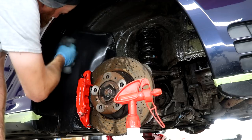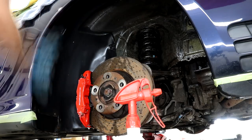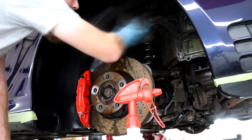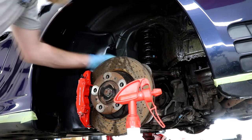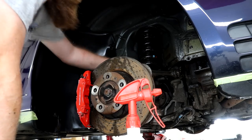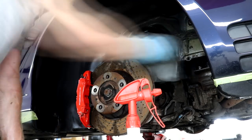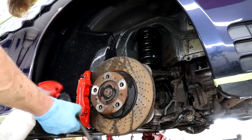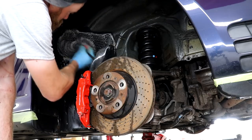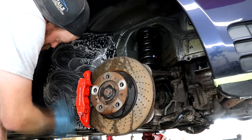Take this for example, then the first initial clean that I gave the arches, well, the product wasn't very sudsy at all, whereas on the second hit with APC, dilution exactly the same, the product is becoming nice and sudsy. That first attempt took the bulk of the grease and grime off, so the second hit is able to clean those surfaces even further. After both attempts, the arches were wiped down with microfiber towels to clean them up, and they were then given a bit of time to dry naturally. With the vehicle already being inside the unit, I wasn't exactly able to crack out the pressure washer.